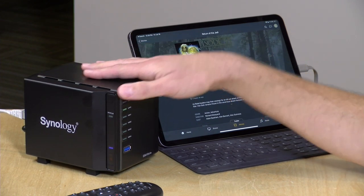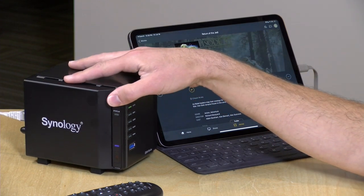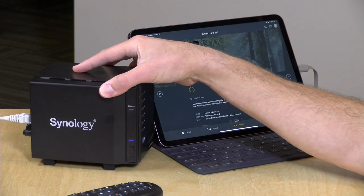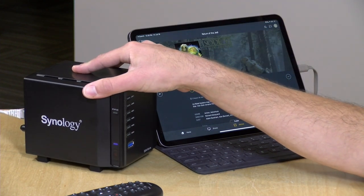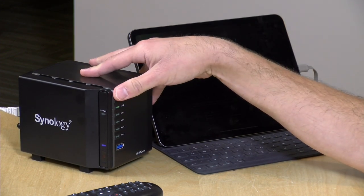It also doesn't support some of the more advanced features that the Plus series devices do, like the BTRFS file system, which does a lot of additional data protection and snapshotting that this one doesn't support. So if you are looking for a little bit more, you'll probably want to look at other devices. In a small form factor, this one isn't bad for what it is — just come in with the right set of expectations. It really isn't all that fast, and I think that might be a turnoff for a lot of folks. Until next time, this is Lon Seidman — thanks for watching.